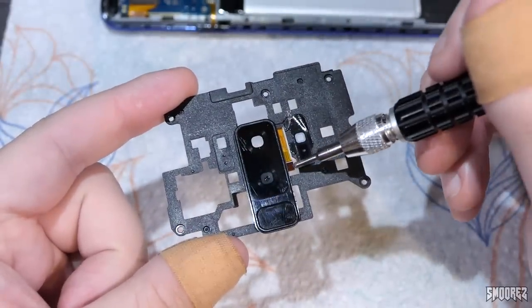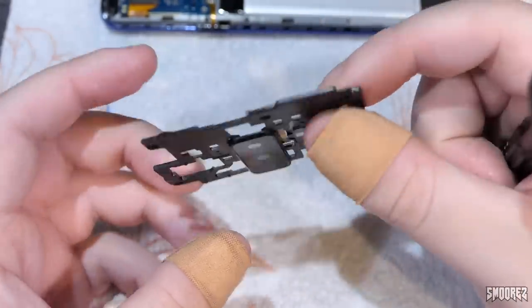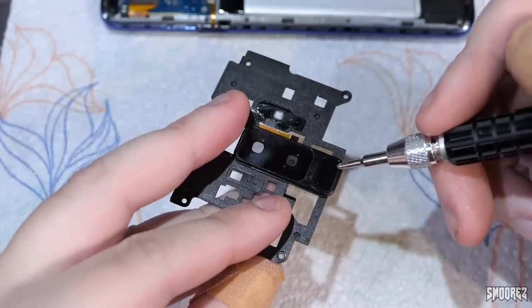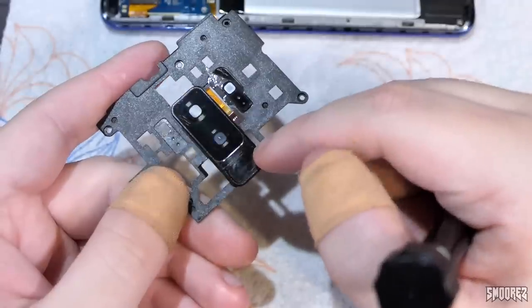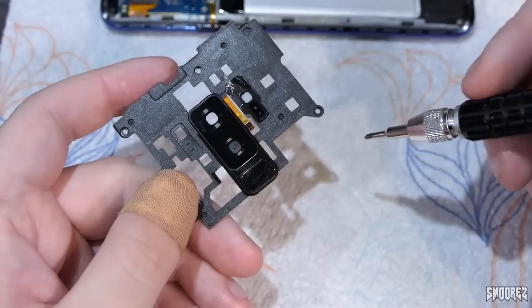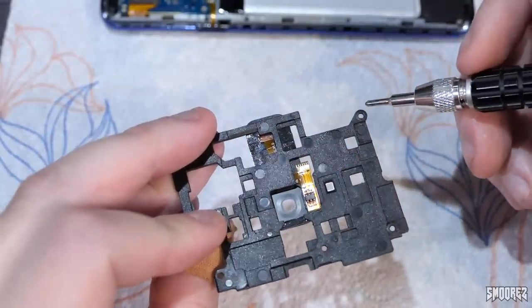When I was taking it off, I seen this flex ribbon, and I thought, that's a bit strange. Surely the camera can't be real. And it turns out, it leads to the fingerprint sensor. This was working because I was using my fingers, my hand, my elbow to unlock it, so this here works, but not as a true fingerprint scanner. It probably actually is one, but the actual security features aren't present on the device. That's my thoughts anyways. The sensors themselves are just plastic underneath them.